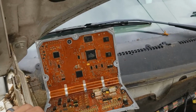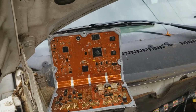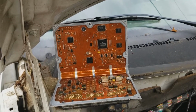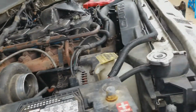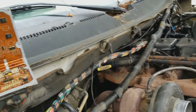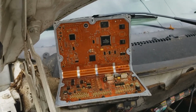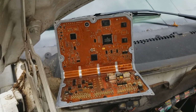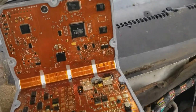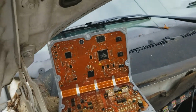Why the computer, the CAN bus, the OBD system was all not functional. The speedometer, the tach. Basically all of the symptoms that the internet talks about when they talk about the electronic speed sensor on the engine or the vehicle speed sensor going out. Same symptoms, only in my case it wasn't just that sensor. So I have a new sensor in there. I got all of the other sensors unplugged, ended up tracking it down to this voltage regulator chip in here, which I replaced. I'm going to post that as a separate video just specifically about repairing that computer.